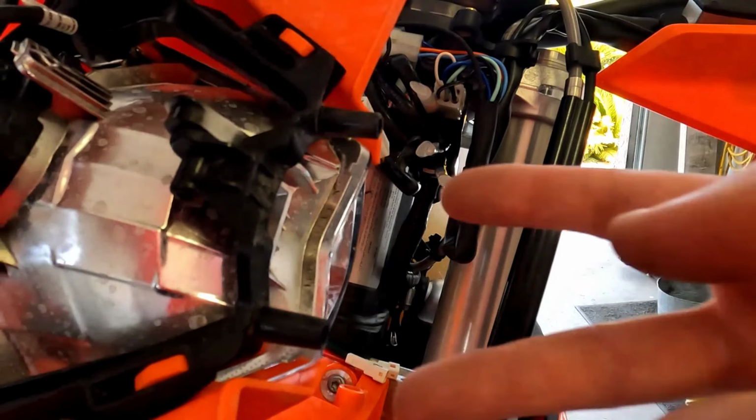Now you've got all your headlight connections. You're going to want to get those up high, and those are going to end up going in this void above the actual headlight in the mask. So you've got your ignition wire, that's going to be up top. Take your turn signal, put that down the bottom on both sides, right? So all that turn signal stuff's going down underneath the light off either side. Headlight connections are going to go up with the ignition connection, and you can get all that stuff into that void so you've got plenty of room.